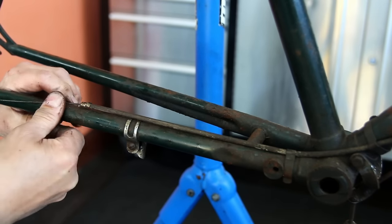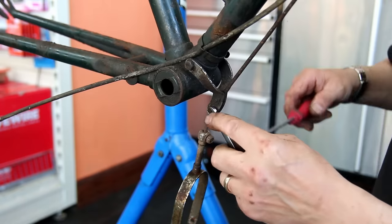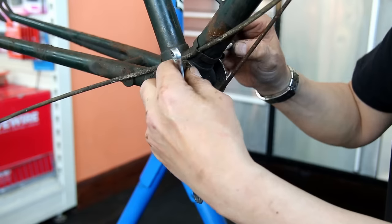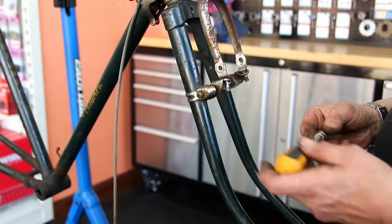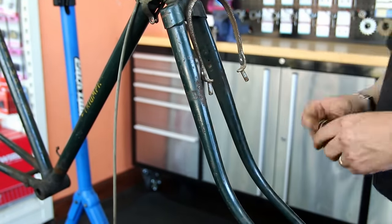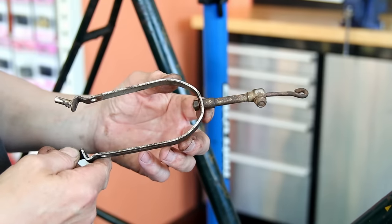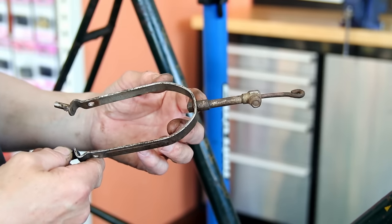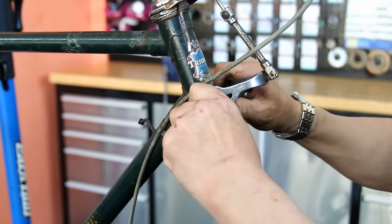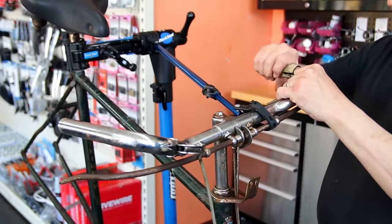Getting off all these old cables and fittings lets us work deep on the frame so that when we clean and polish it, we haven't got fittings in the way. All these parts are pretty rusty — we clean off as much rust as we can, polish the component, and then treat the metal with a ceramic coating just to stop water sticking to it and prevent further deterioration.